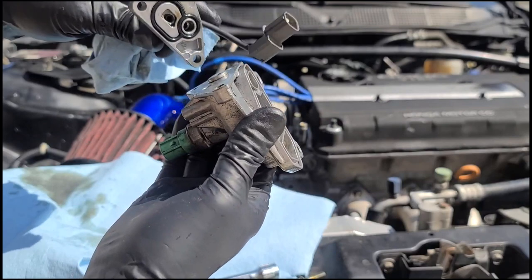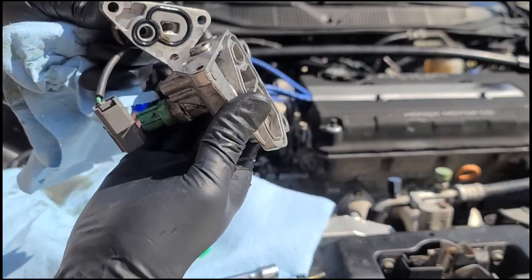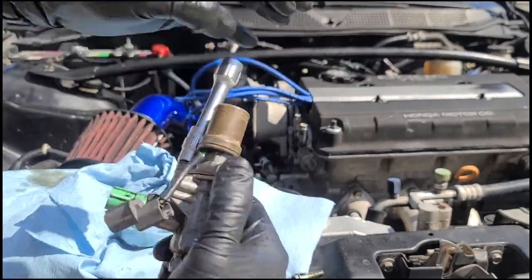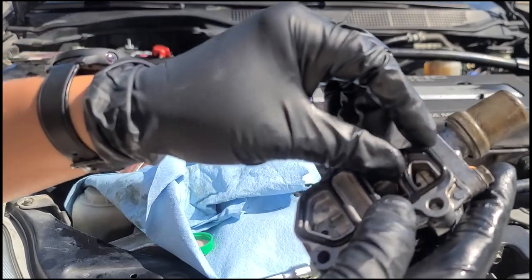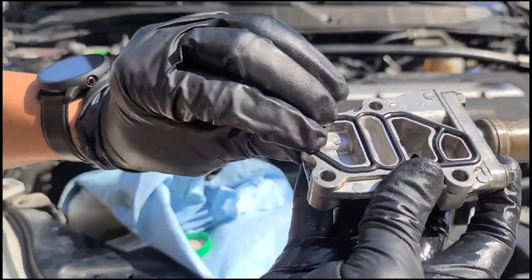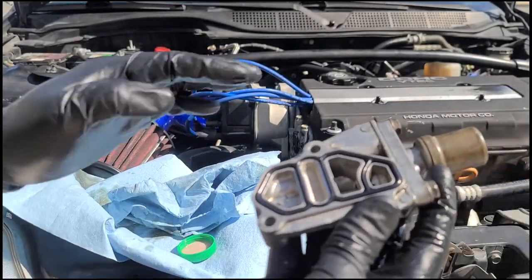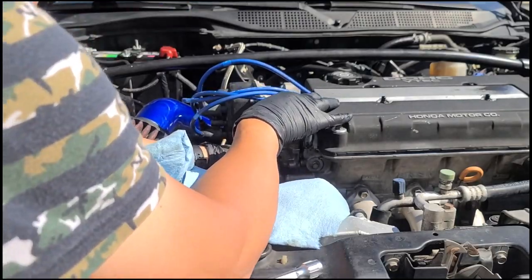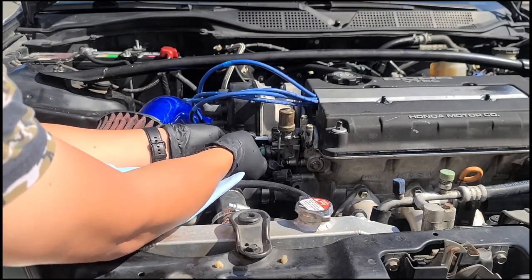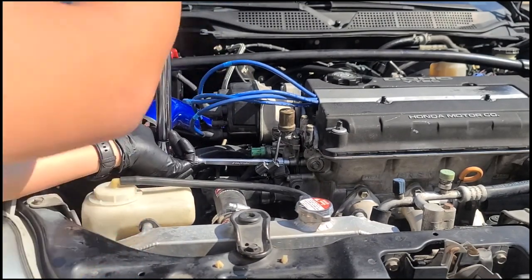Adding the top part of the solenoid takes a little pressure, so you're going to need two hands, the bolt, and some patience to get it lined up — it's not too hard, just take it easy. The other gasket is going in now and there's only one way to do it, so you can't get these things backwards. I'm also doing another fresh coat of oil for better sealing. After bolting everything back up, I'm going through all six bolts with a torque wrench and getting to nine pounds of torque. Don't over torque it — the bolts will snap and you will have a bad day.